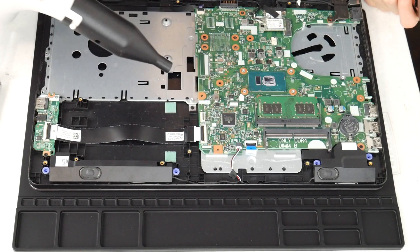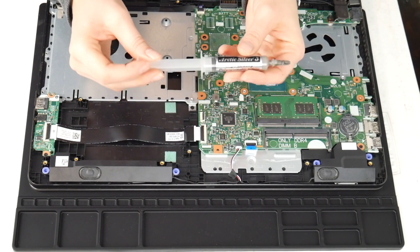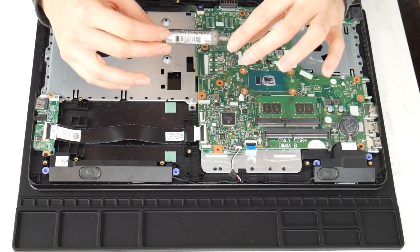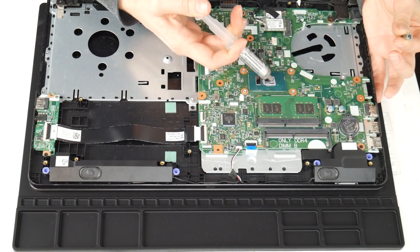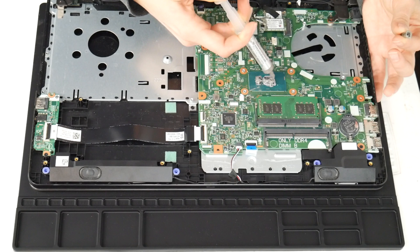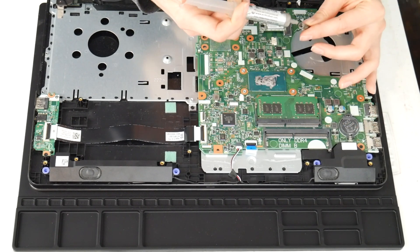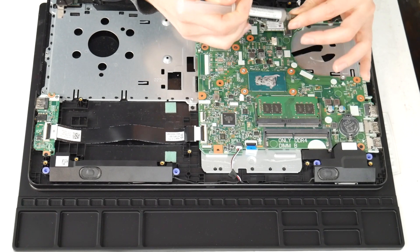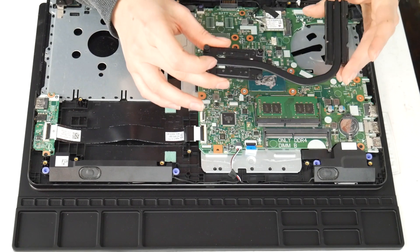This one's not particularly dirty, but sometimes you open it up and they are filthy because you use your computer for everything. The next thing I'm going to do is use some thermal paste on the CPU. I recommend cleaning off the CPU before doing this. As you can see, it's dried out and there isn't much on there, so I go ahead and put some new thermal paste. I've put a link down below with some good quality thermal paste, because not all thermal paste is created equal — you've got to get the good quality stuff.